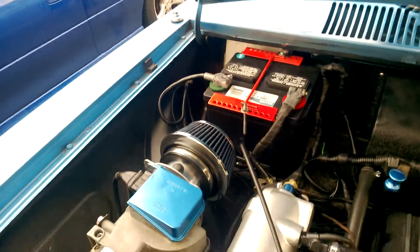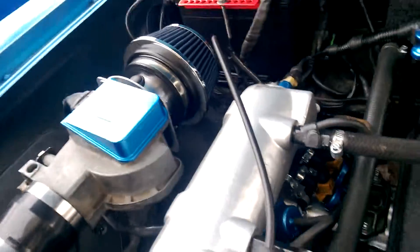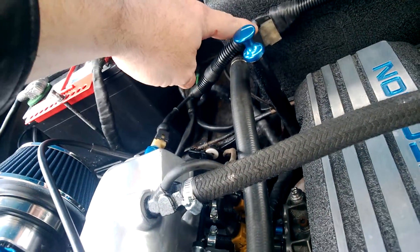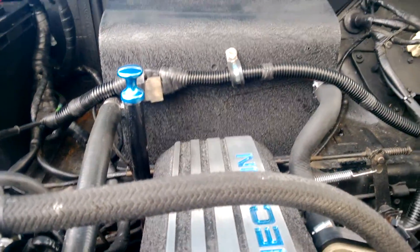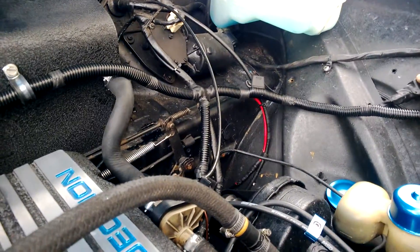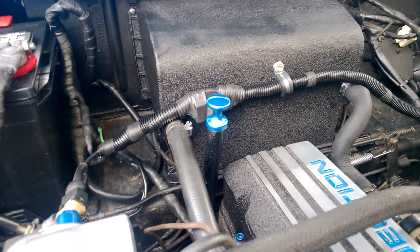The wiring is pretty straightforward. You use all the normal wiring that comes with the kit, or comes out of your other car. You've got a basic plug here, which I had pictures of on the website. I come in here and put a relay and a fuse for my main circuit that comes into the computer, which is hot all the time.